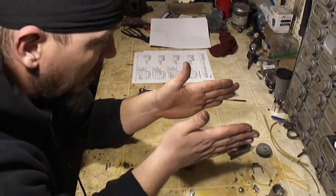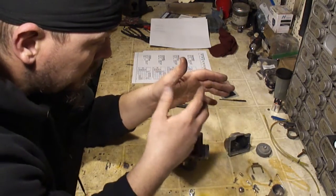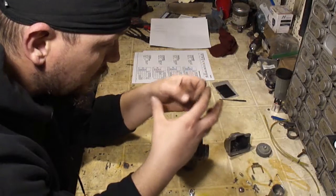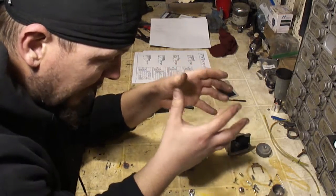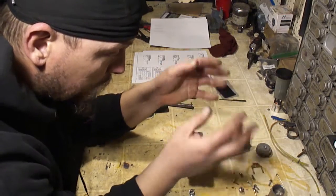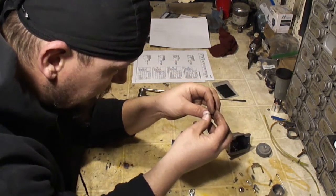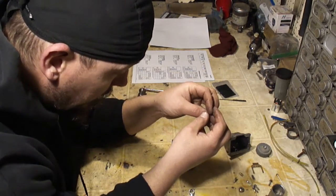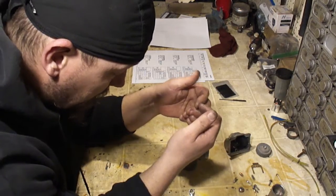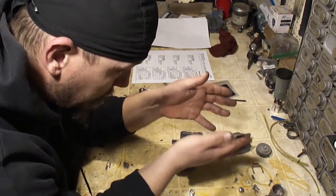If you take a cube, okay, there's so much density in that. And as you heat that up, there's going to be less air in that space, if that makes sense. If you cool it off, there will be more air. The air molecules are going to be more densely packed when it's cold. So when it's cold, you need more fuel because there's literally more air, more oxygen molecules, the colder it gets.